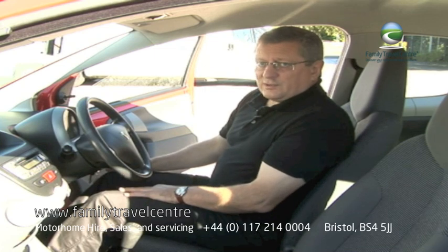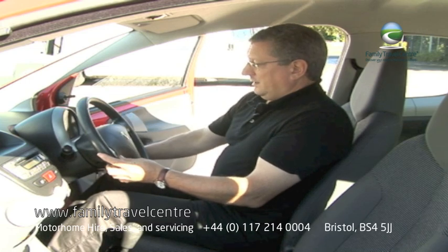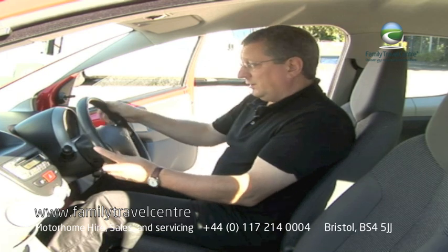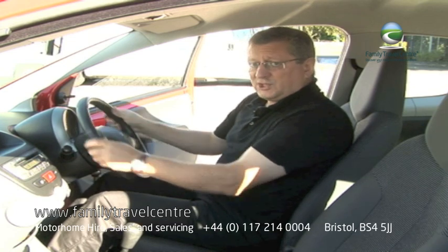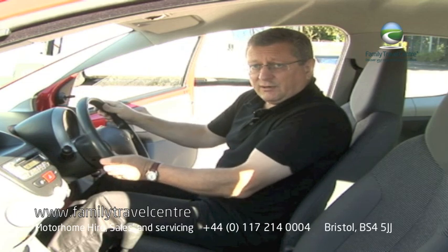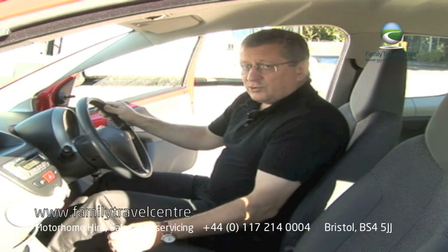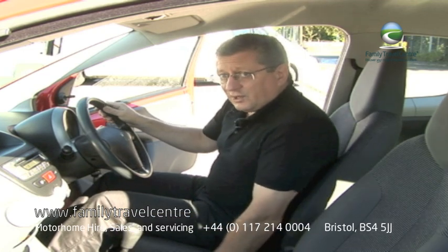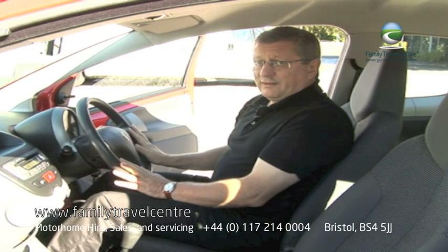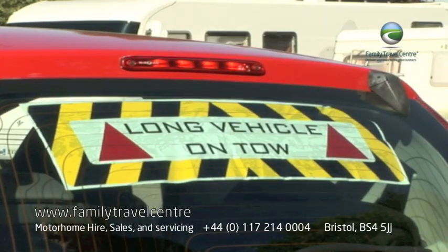And there's just a few checks that we have to make sure that the car is safe before we drive off. Number one, we turn the key fully on, wiggle the steering wheel, move it back one position and double check that the steering is still moving. We then make sure that the car is in neutral and we check that the handbrake is off. And those are all we have to do. And finally, we fit the sticker inside the rear window.